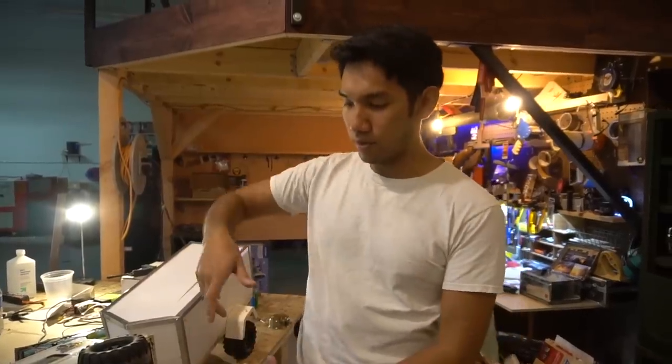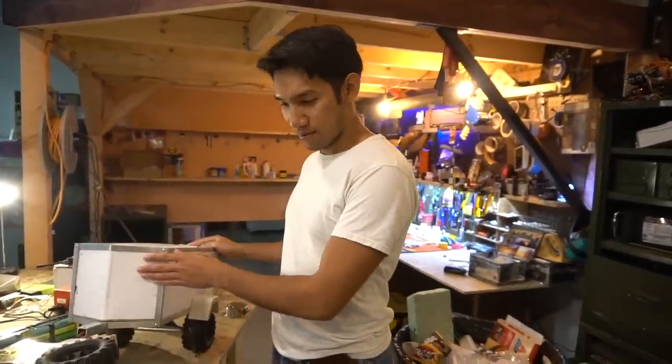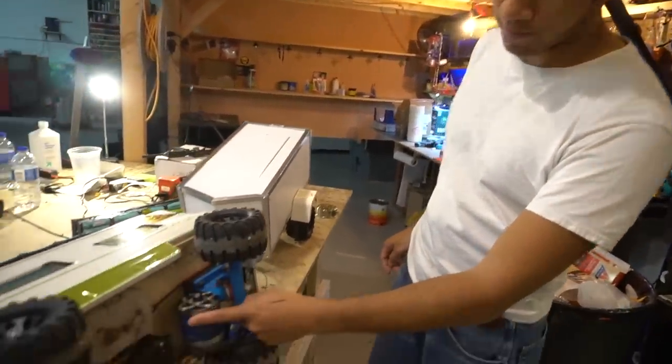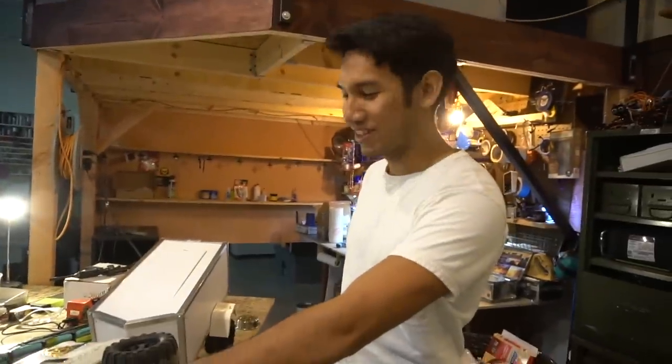Because the ESC would rely on feedback from the motor turning to get going. So if you were sitting on a normal skateboard, it wouldn't work. But with these new controllers, we can actually start from a standstill and go, which is pretty cool. And braking is actually really nice too. Thanks to Hobbyking, they sent some motors too. So we mentioned those, the SK8 skate series motors.